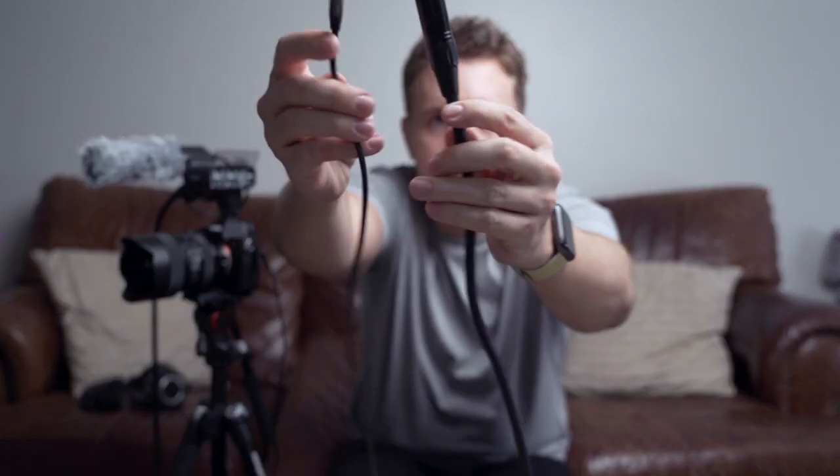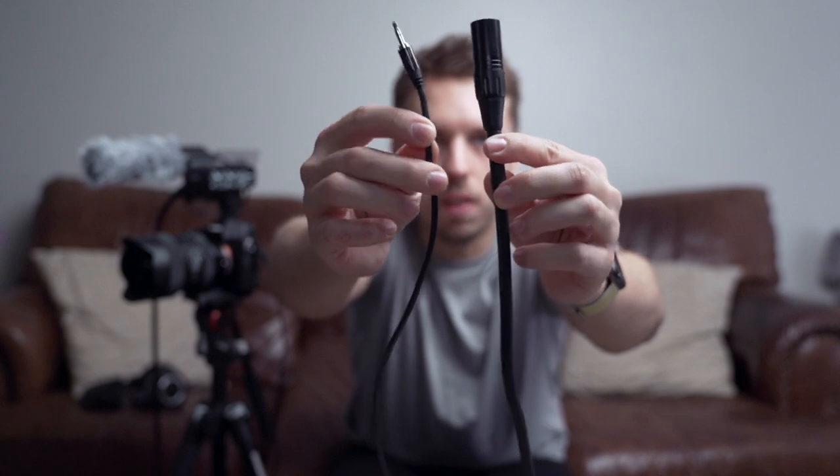I've been hearing really good things and I also love Rode, so I got the NTG 5 recently. Whenever you're not using professional mics like this, you have to use 3.5mm cables instead of XLR. As you can see, there's quite a difference in thickness between these two cables. XLR cables are more balanced, sturdier — I get the Pig Hog cables and I've never really had issues with them. With cheap 3.5mm cables there's more risk, and I always super glue all the joints as extra protection, but it's just not as professional.